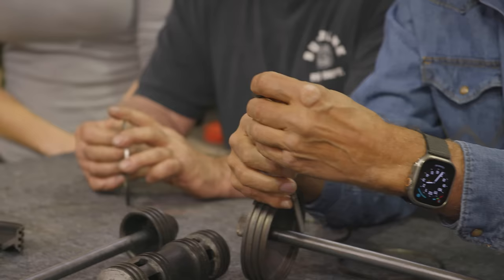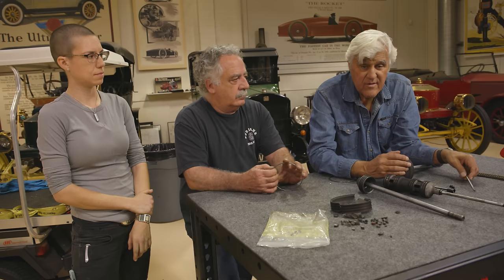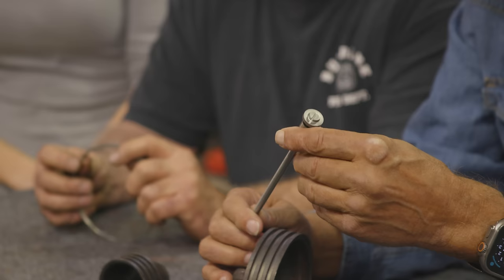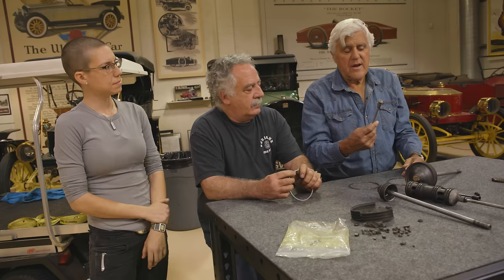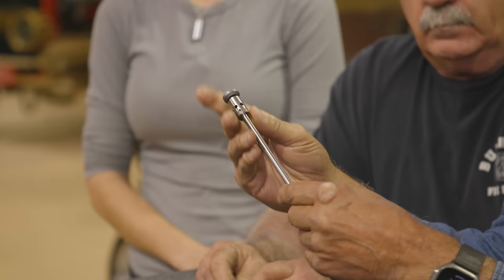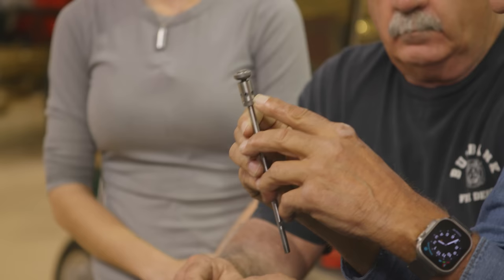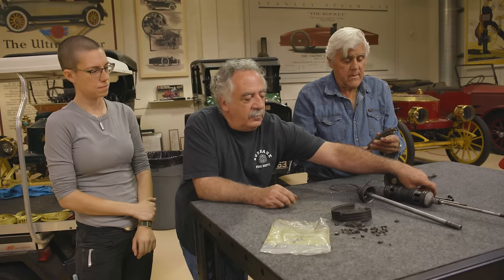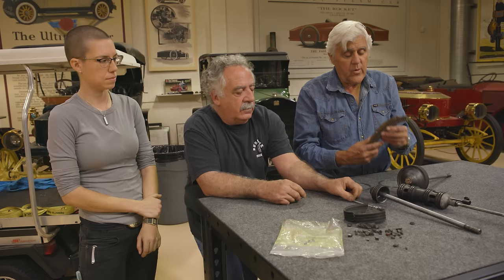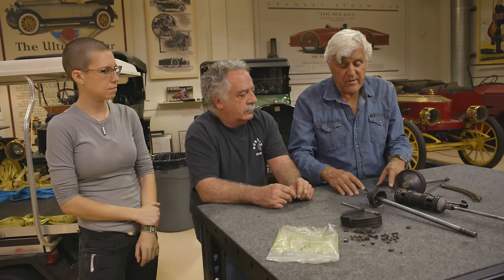This is the throttle. We opened it up and got all these pieces out with no idea how it went together. We gave it to MS Aerospace and said: find an alloy not susceptible to rust, deterioration, and high temperatures — it's only a thousand degrees. So we went to Czechoslovakia for this particular stainless steel. MS Aerospace does high-tech machining for aerospace. Steam goes through these little holes — you wouldn't think those little holes would be enough to push a 6,000-pound car at 75 or 80 miles an hour, but it really works. This is a thousand foot-pounds of torque — the minute this thing lifts off its seat, a thousand foot-pounds goes through this. This is one of the turbine wheels that blew up. You wouldn't think steam would literally blow something apart like an explosion, but it really did.